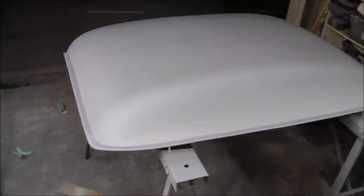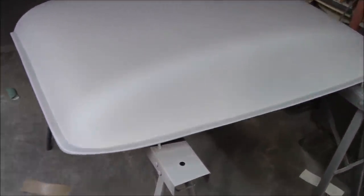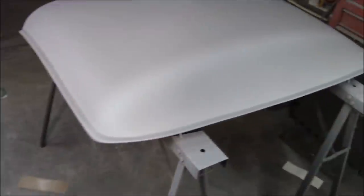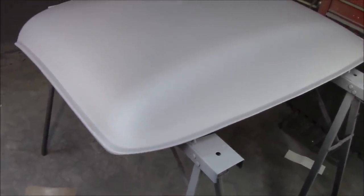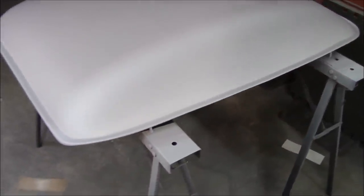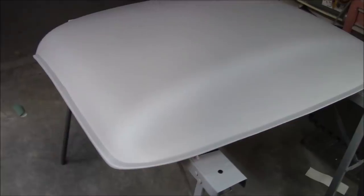End of the night on Friday and we've just brought the top inside the garage to continue its drying cycle overnight. We'll get back out here tomorrow morning with 600 grit sandpaper and scratch this down before we get it into that graphite colored base coat that is color matched to the wheel centers. Then we'll hit that with probably three coats of base and probably three or four coats of clear coat. I don't want to be spraying anything inside the garage so we'll see how things work out outside. I don't think I showed you the actual vent cover — it turned out okay — but this hard top section is a significantly larger piece, so we'll see how we do tomorrow.